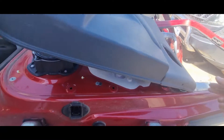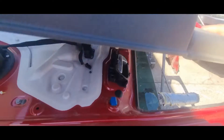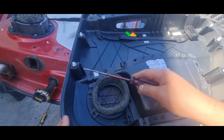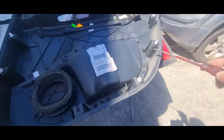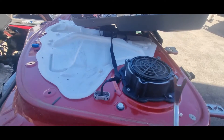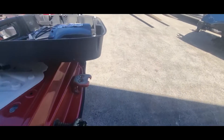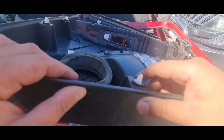Pull the bottom up out of the door and then slide it upwards to detach the door trim from the door shell. These are the white clips all over the inside of the door trim. As you can see, one of them has sat on the door shell. If you're going to refit this, any clips that remain on the door shell — take them out and put them back onto the door trim, because it's a slide-in process and when fitting back it just makes it so much easier.